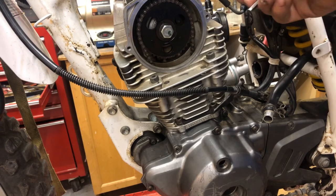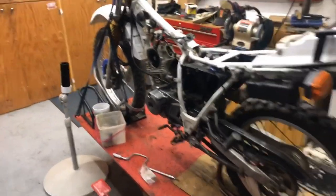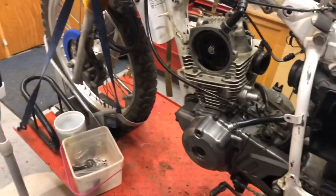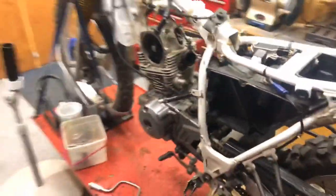I'm basically going to call it for today because I want to make sure everything is lined up when I install those valve adjustment screws so we can set the valve clearance. There she is — pretty much done: new valves, new piston, new rings, new gaskets. I don't have a tank, carburetor, battery, or air cleaner, so I can't run it yet. If I get those parts I'll make a quick video on how it operates, but I'm not anticipating any issues. If you're digging what I'm putting out, give me that thumbs up, click subscribe, leave a comment below — thank you very much for watching, get out there and find your adventure. Adios.